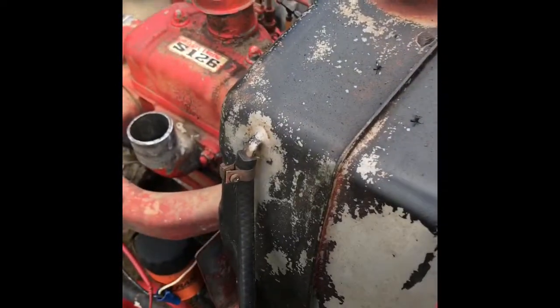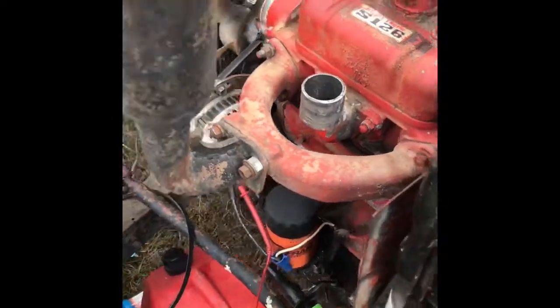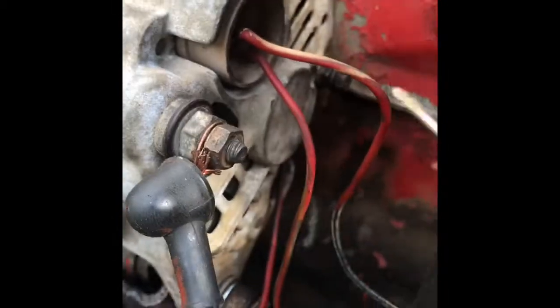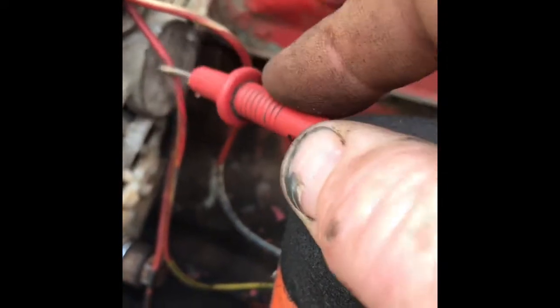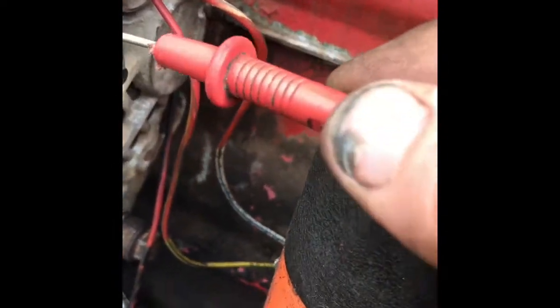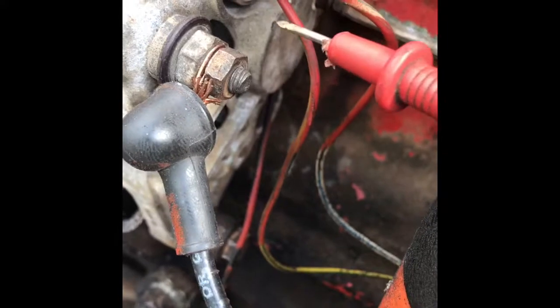So that's good to know. It was working initially without these connected, but the voltage coming in kind of excites the alternator — kind of like a generator — allowing the field to be charged and then putting out power again. Without this, at very fast idle I was getting 13 volts, and at normal idle 12.9 volts — not good enough to charge the battery.